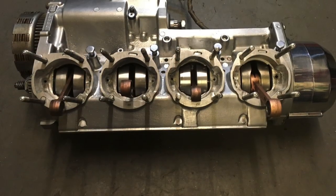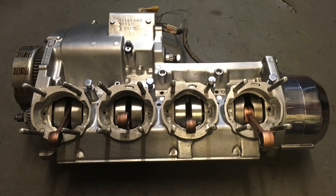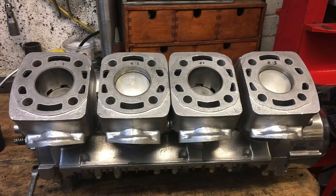The crankshaft is made from Yamaha parts so it didn't match with the Kawasaki alternator or Kawasaki primary drive sprocket, so I had to remachine them. The barrels I had vapour blasted to give a nice silver finish to match the Kawasaki crankcases.